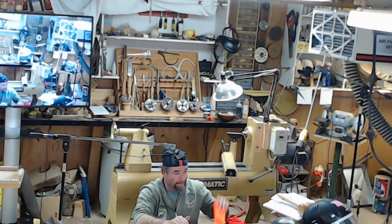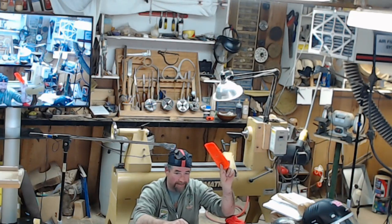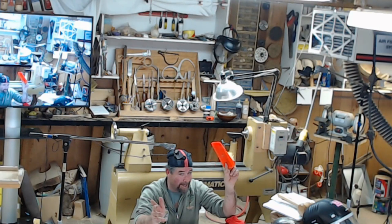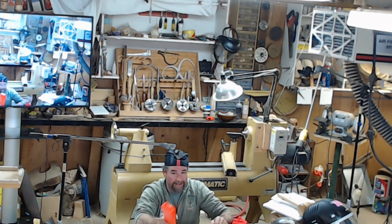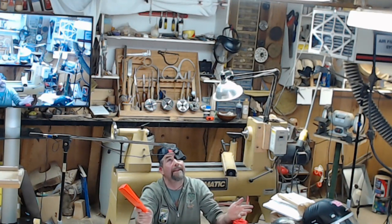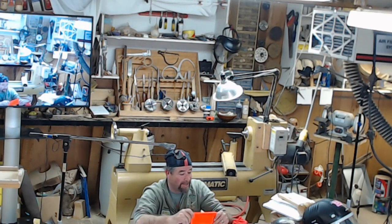If it still doesn't go because of your hinge wood, you know, use a wedge, a plastic wedge. Don't use metal wedges, because that'll dull your bar and then you're stuck. And literally, if your saw can't cut and you've got this thing standing there, one good wind can blow it over at this point. So make sure you put a plastic one in there, because even if you hit them, big deal.